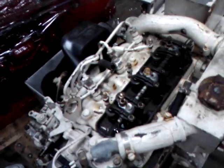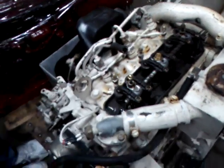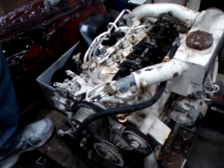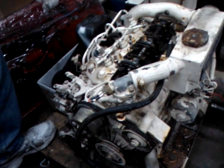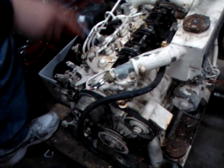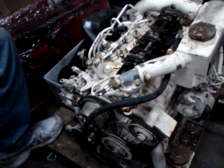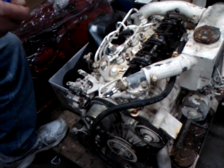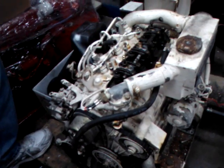Which one of these do you call the number one cylinder — is that the back one or the front one? It's generally on the front. Because this is the same engine they're talking about over there, the 27 — pretty much the same thing. When you go out to Westerbeke, come to that site, it's going to give you all the pictures. They'll say this is number one cylinder — turn it X amount of times so you get to this. Then use your feeler gauge there, go to your number two cylinder, do the same thing.